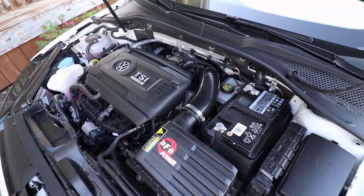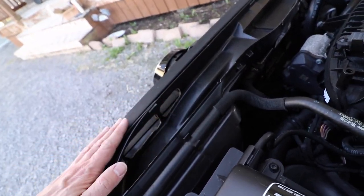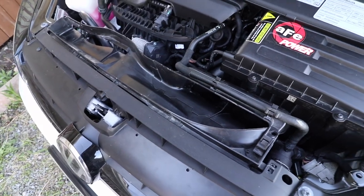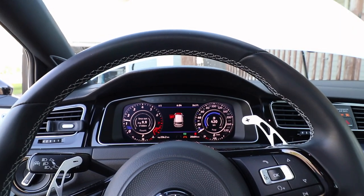Just have to put that cover on and then we're ready to test. One last thing about the opening mod: if I ever decide I want to close it up again, all I have to do is put a piece of black gorilla tape over those holes to block it off if you're concerned about moisture — but it should be fine. That's the intake mod done. It certainly sounds better — well worth it just for the noise factor alone, you can hear a lot more air rushing into the engine. So the best modification for the intake on these Mark 7s is open up that front air dam, put in a high flow dry filter, a turbo inlet pipe, and a silicone hose — and you've got 98% of what the most expensive air intake is. If you enjoyed this video hit that like button, if you're new subscribe, and leave a comment down below. Thanks for watching.